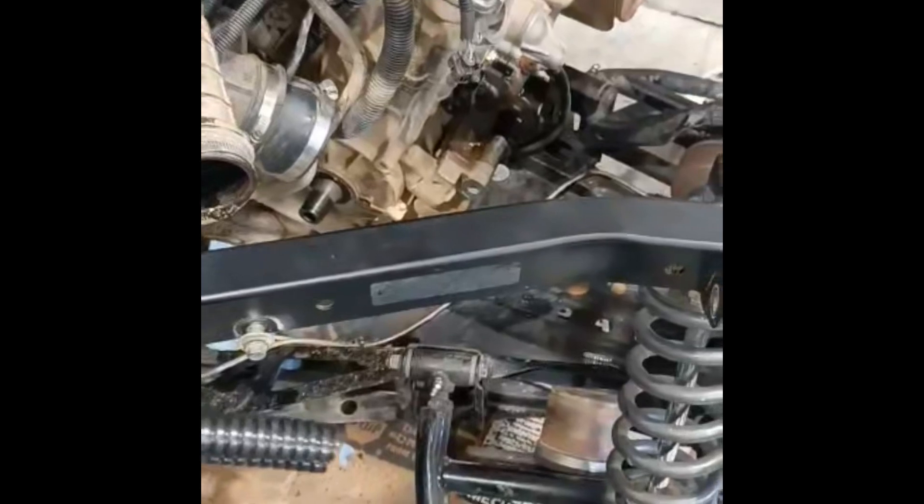From there back to the passenger side and the driver side, there's been some rubbing going on. This sleeve might save you, because if you rub a hole in one of those brake lines, there's a pressure switch that automatically shuts you down — it's a safety thing. I'm going to put this on there and try to get the full life out of these brake lines. You can see now the wire loom is on the brake lines, just giving a little bit more protection.